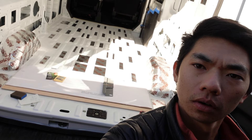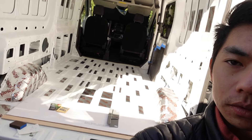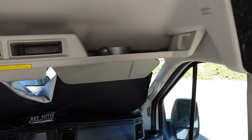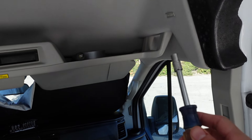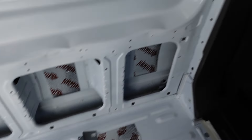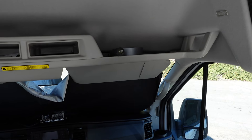Quick lunch break session. We're going to try to drill some holes for the mounting locations of our Vancellery headliner shelf for our transit. We got the included brackets here. I got my 7mm socket on. We've got to go into our existing headliner, remove the screw there, screw there, screw there, and screw there. Seat our brackets in those locations, and then we'll place the wood on top of that and mark the holes.